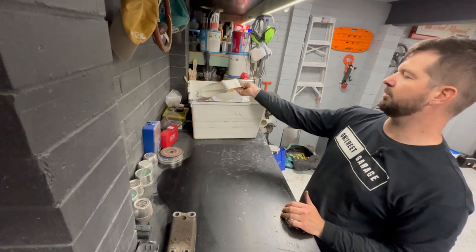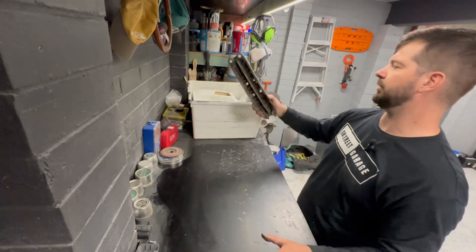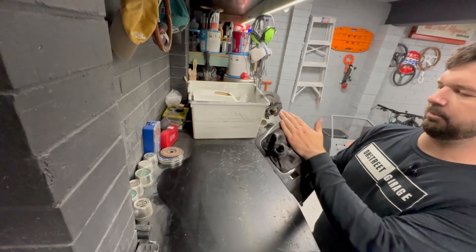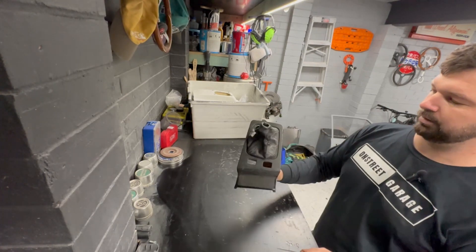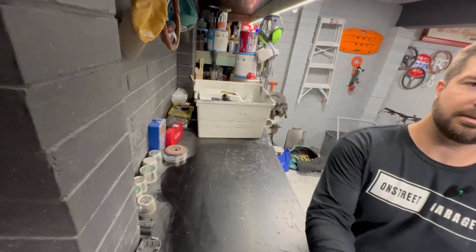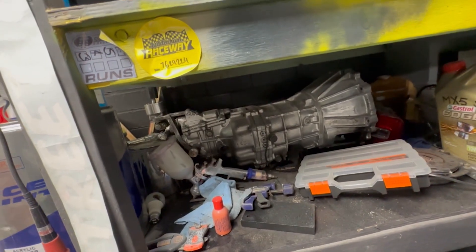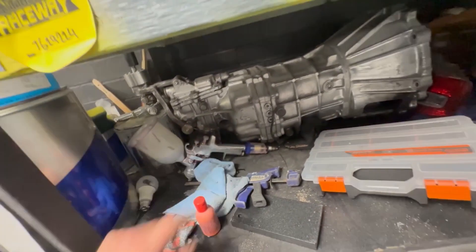Got an oil seal rear main which needs to be done anyway, shift boot, and a fiberglass hump — which you apparently need when going from auto to manual to make it all fit nicely. Another support cross member. There's a 3D-printed manual surround — I think there's a guy in Russia who prints them and it's a pretty amazing job. And probably the most important part: I've got an R154 gearbox under there; it had a Cube short shift on it when I got it, and there were some rubbers and bits that needed doing, so that's all been sorted before it goes in. If you think I'm missing something for that kit, let me know.